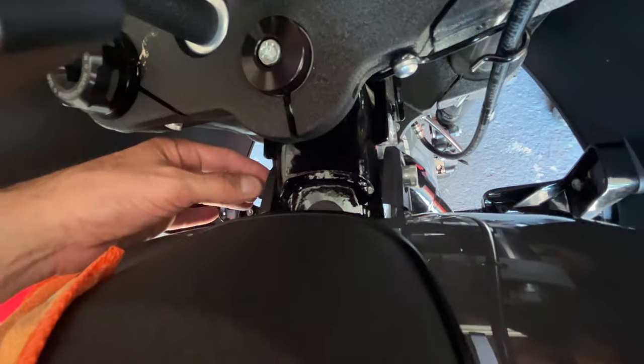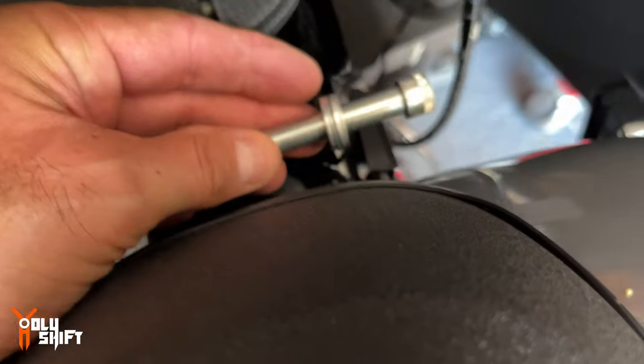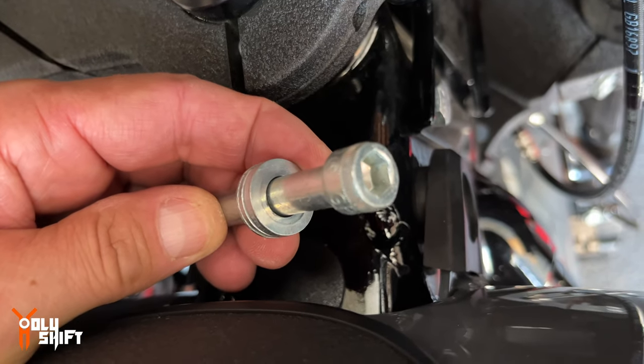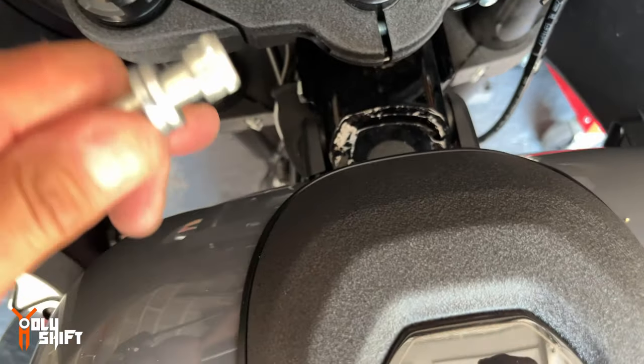Now I'll take out the front bolt right here, and then we'll remove the tank. They say it's better off to have a quarter tank full or whatever, otherwise it's very heavy. Very carefully and gently, I got the front bolt out. Obviously over here, there's an Allen key, and on the other side, an open wrench. Slowly, I had the fuel tank covered so I don't bang it.